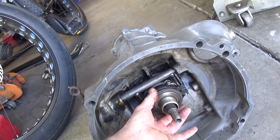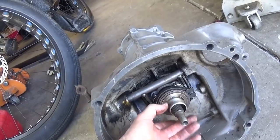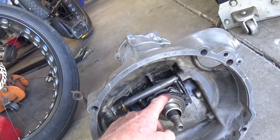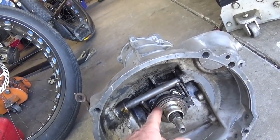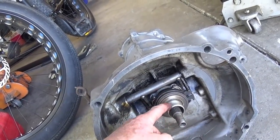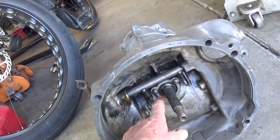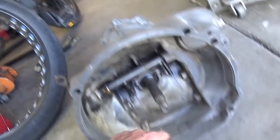Now, that's an expensive pressure plate on that Kennedy setup, and it's balanced to that engine, but I don't know. I wouldn't use that old setup, the early setup with that. I'll look at the fingers and see how everything looks underneath that. We'll do that together. But I think it'd be better to change out the transmission to the late style. I don't want to drill into here and try to tap these holes. I don't think I can get it centered perfectly without a jig.